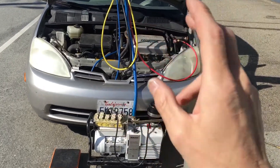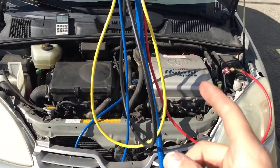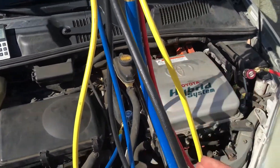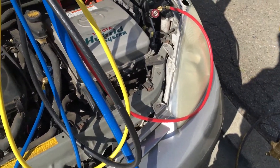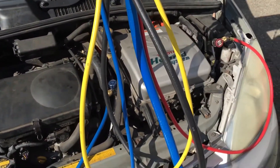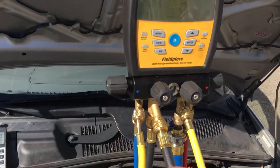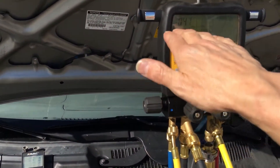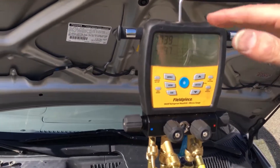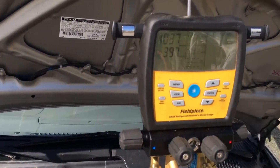Video 3 on the air conditioning on this Prius Gen 1. Now into the vacuum procedure. I already bled out the nitrogen that was in the system, then hooked up the vacuum pump. I'm pulling it down and stagnating right here around a thousand microns — it's starting to level off and not really move much.